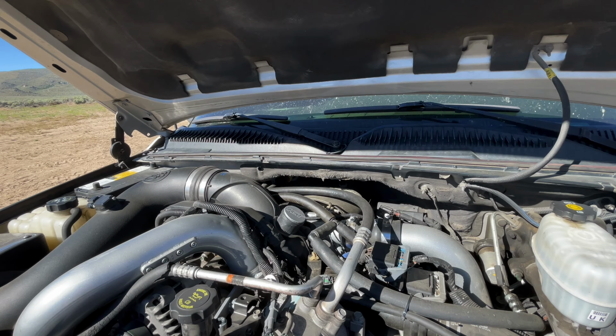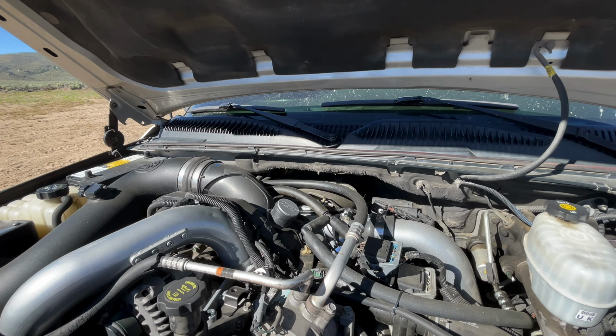I did do it myself, so I bought their LLY exhaust housing, and then the rebuild kit came with a front cover. So the cartridge for the turbo is the same. The back plate is the same. It has the bigger front cover. So essentially an LLY turbo with a billet wheel and a 10 blade. Just rebuilt with like the 360 thrust washer and all that good stuff.